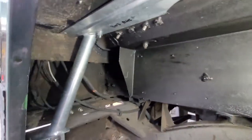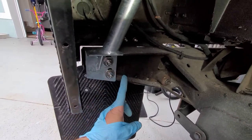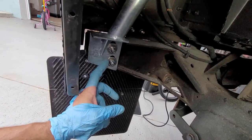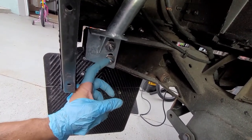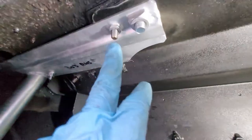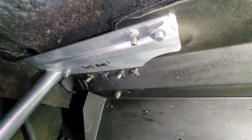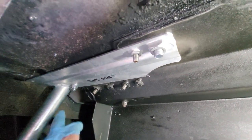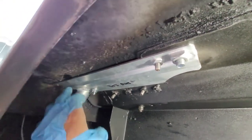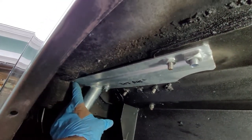So these are the seat belt supports installed. I put the longer bolts that I got over at Broward Bolt — a lock washer and a nut on the inside, and then the length that protrudes out here gets another lock washer and regular nut, all fastened right there. Then at the top, I lined this up — I had to remove two of the large rivets I had already put in the plate above it, but that's all right because this is holding it all together and it's already seam-sealed with panel bond. I drilled this hole and put in one bolt with a lock washer and a nut right there.